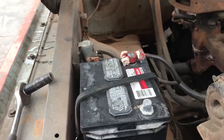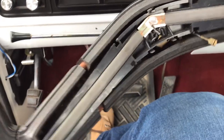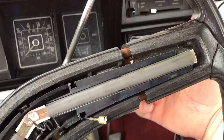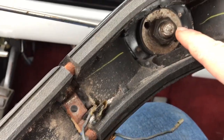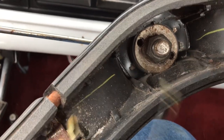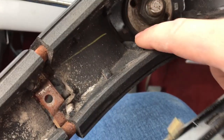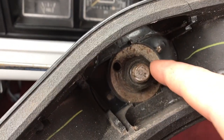Let's get back to the steering column. The first thing I did is take out the two screws — there's one over here and one over here — that you thread out from the backside to pull this cover off. These two wires are connected in here: this one's your power, and the other one just jams in and it's your ground.